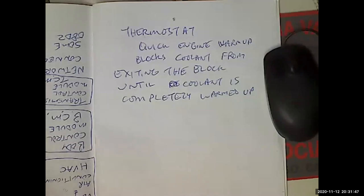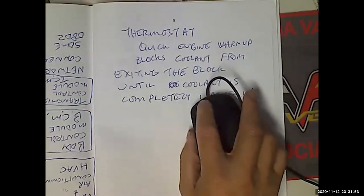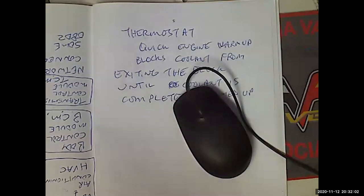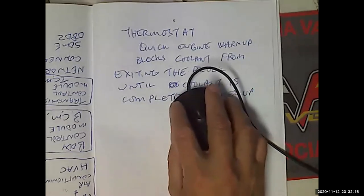But now on many cars, that's not the case. So what you have to do is bleed the cooling system to get the air out of it. And folks, if you don't get the air out of this cooling system, you're going to have big problems, because the air bubbles will stay there. It's like if you have a double trap in your drain system, it'll completely stop the flow coming out. And it'll do that in your cooling system too. And that'll make you very, very sad.